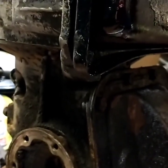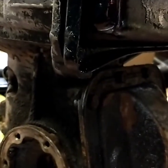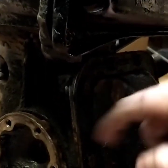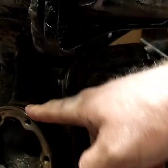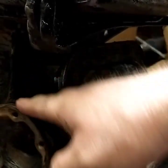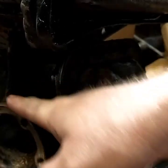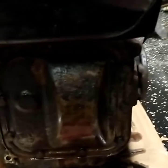ATF from the transmission — because the input shaft goes through here and the output shaft goes through here, kind of a funky setup. We gotta separate these two housings. I did not get new seals for the sides because when I ordered them they didn't list them, and I'm thinking they're just standard type-2 seals. I don't see why Volkswagen would make a different seal for that — seems cost effective. The stubs are probably pretty much the same, but who knows.